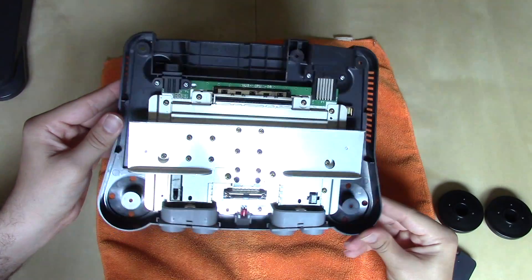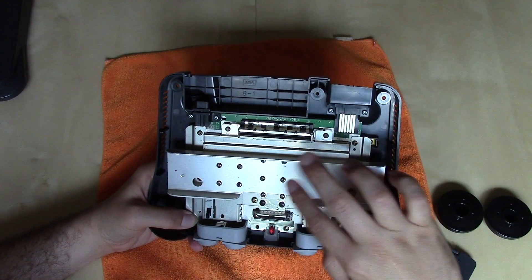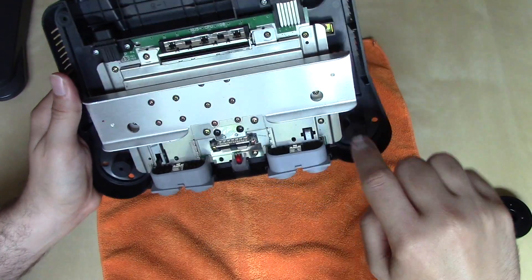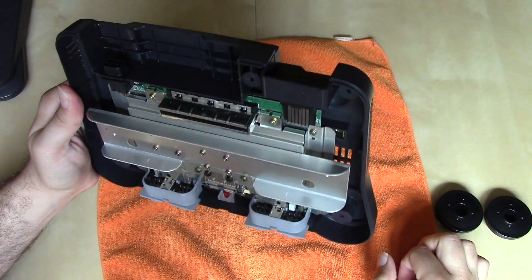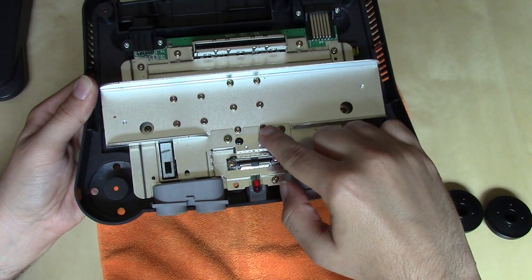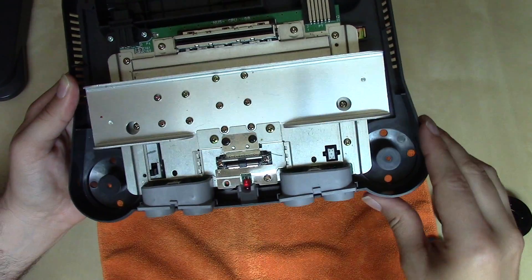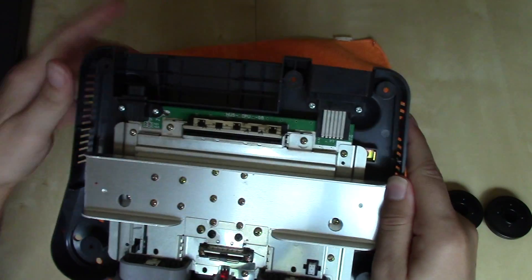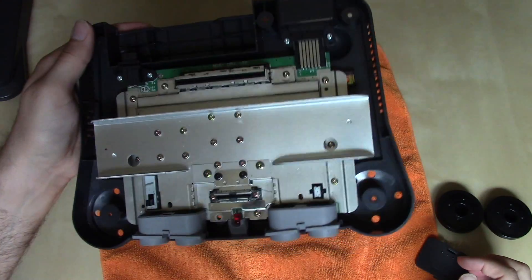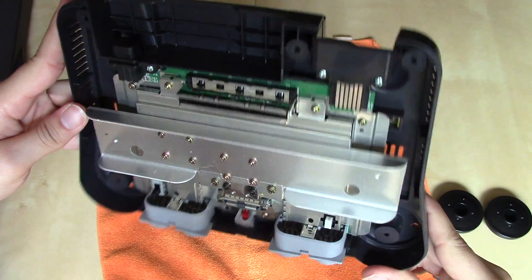To remove everything you'll be using a standard or smaller Phillips screwdriver. Just holding the heat sink on alone there are 14 screws holding on this one piece. Once you get that up, there are several more screws. The two screws in the center are a different size than the ones holding on the heat sink, as are the ones holding a shielding piece for the expansion port. There are two screws through the expansion port that are yet another different size, and then there are silver screws back by the AC in and the multi-AV out. The N64 really requires that you take a picture before you disassemble to get the screws back in the right places.